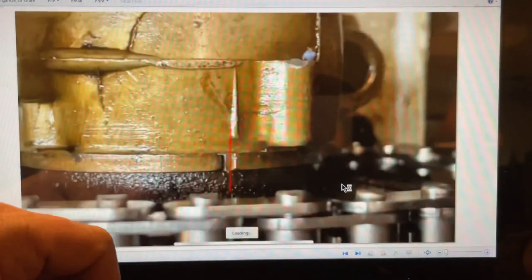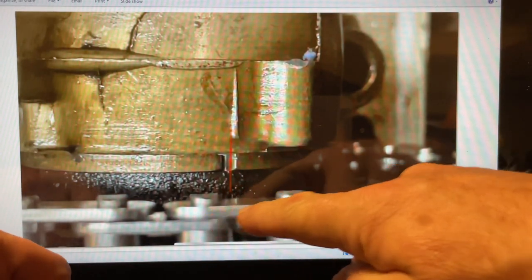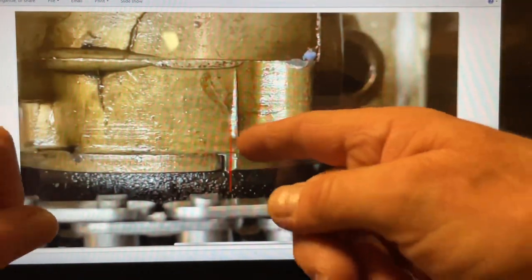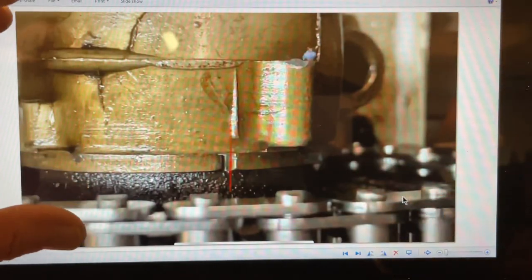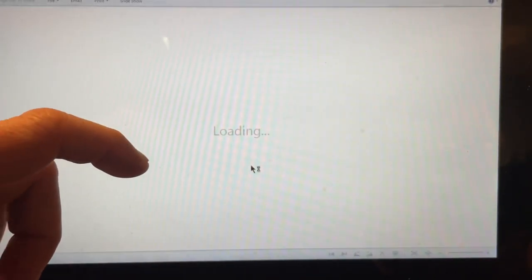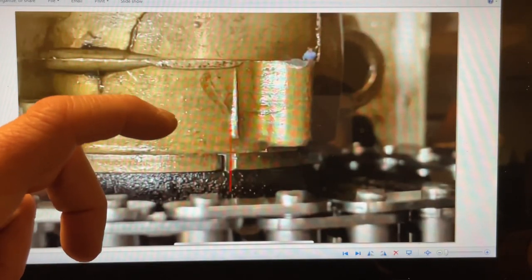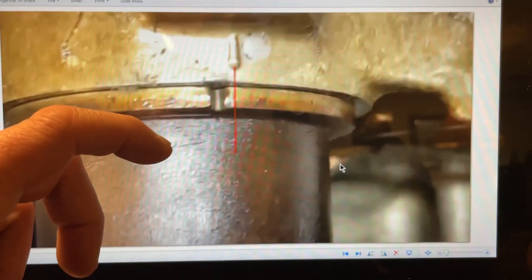Then the next mark is the mark on the crankshaft on the driver's side — the left side. You can see the timing chain here. This rib in the middle is exactly over it when you look at a different angle. So we have the crankshaft pulley lined up, the distributor lined up, and the left camshaft lined up. The right one will fall wherever it falls in this process.